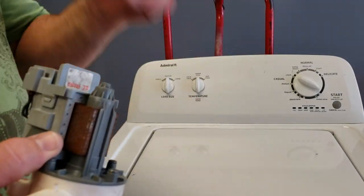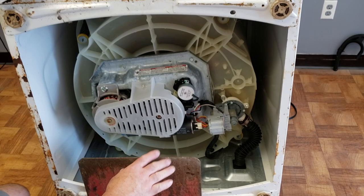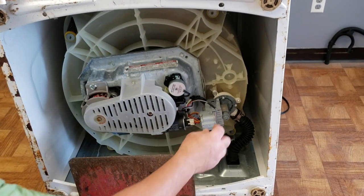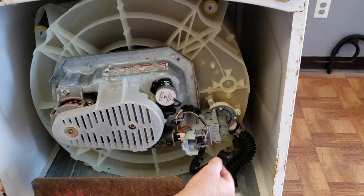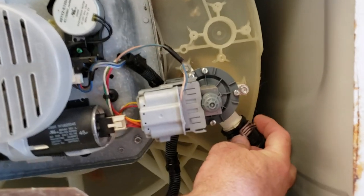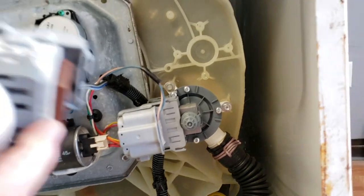So basically, if you have a washer like this stuck in wash, water is inside the tub, and it won't let you do anything else — it's a good chance it's going to be the drain pump. I'll show you where it is. Here we are underneath the washer. Here's your drain pump. It's held on by three screws and a hose clamp for the drain hose, plus the power plug. You'll take out three 5/16 screws, get some pliers and undo the clamp, pull the clamp off, and your drain pump will be free.